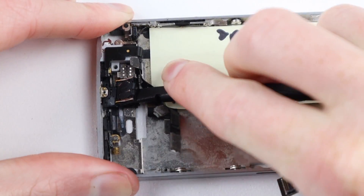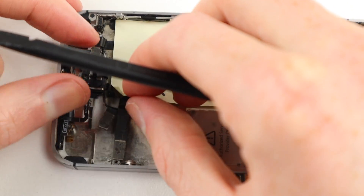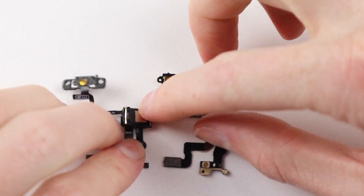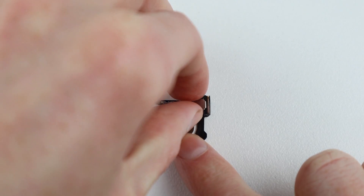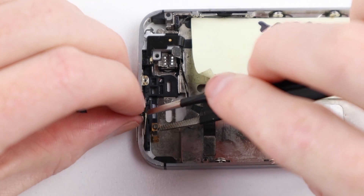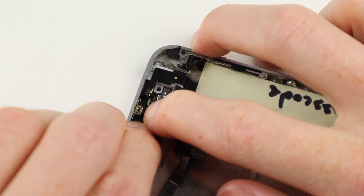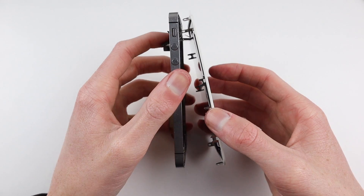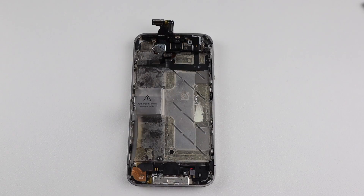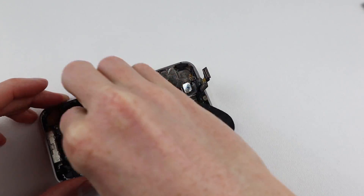With the screen off I removed the power button assembly by taking out the earpiece and the two screws holding the power button bracket. I transferred the earpiece to a new assembly I had in my parts bin and installed the new power button, making sure it's clicking correctly, then installed the rest of the cable assembly including the earpiece and proximity sensor, which were a little tricky to align. I installed the new screen back onto the iPhone 4s, pressing it down with no gaps, and used isopropyl alcohol to clean the metal mid-frame which had a heap of fingerprints from being a test housing.